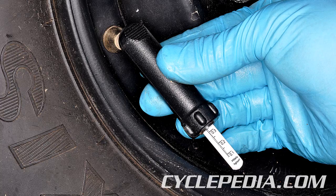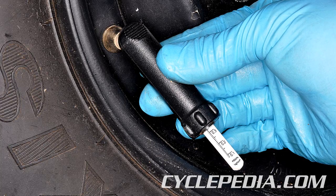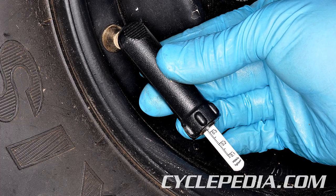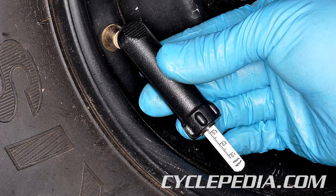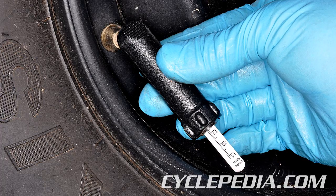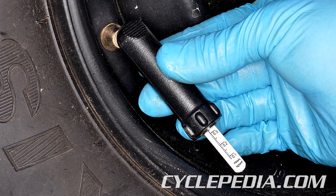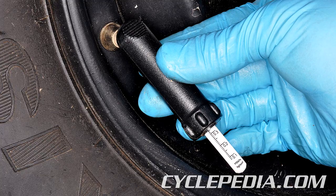Make sure the tire pressure is set correctly for all 4 tires. The air pressure in the front tires should be as close to the same as possible. Place the vehicle on a level surface and position the steering head straight. Be sure to check with an appropriate service manual to see if there is any extra specifics for the vehicle. For example, the Suzuki Eiger says that the vehicle should be weighted so as to simulate a rider.